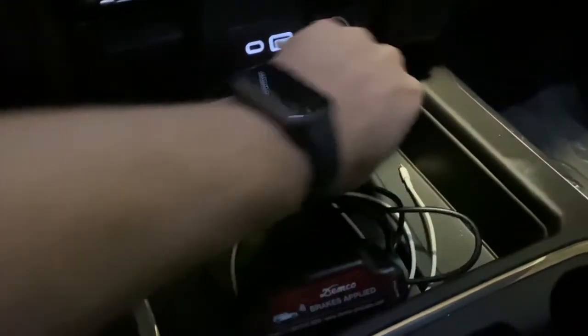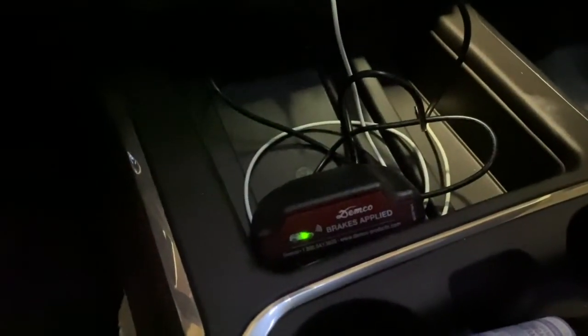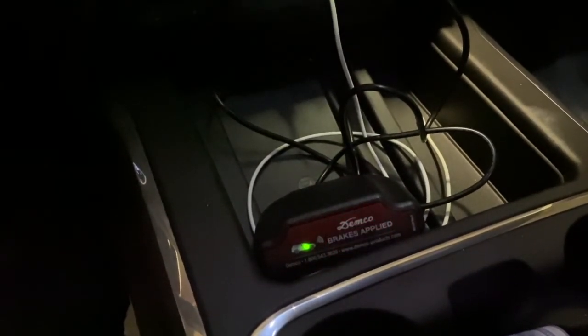To test the wireless CoachLink, you can plug it into the auxiliary plug in the towed vehicle. A green light will light up indicating that it is paired. Then lightly push on the brake pedal while you pull out on the back of the actuator. You will then see three lights illuminate on the CoachLink.